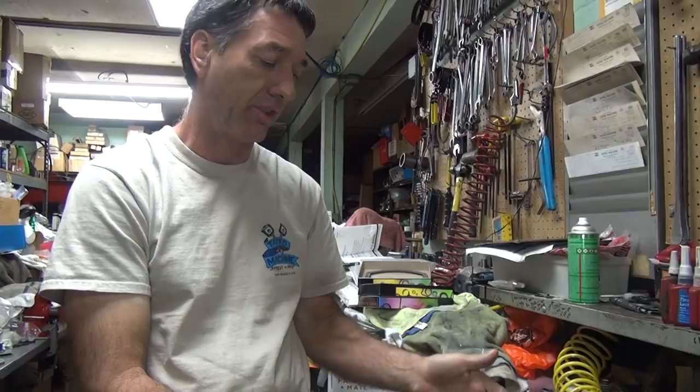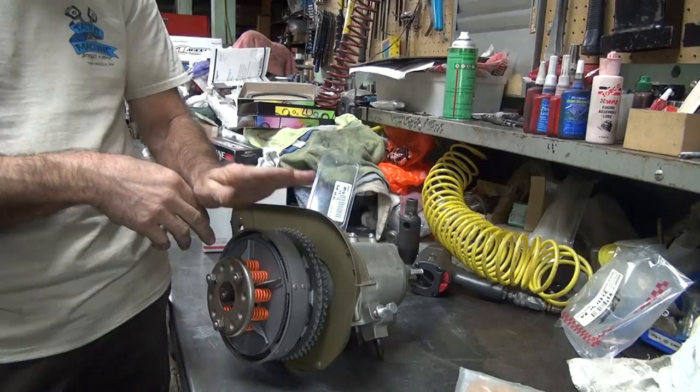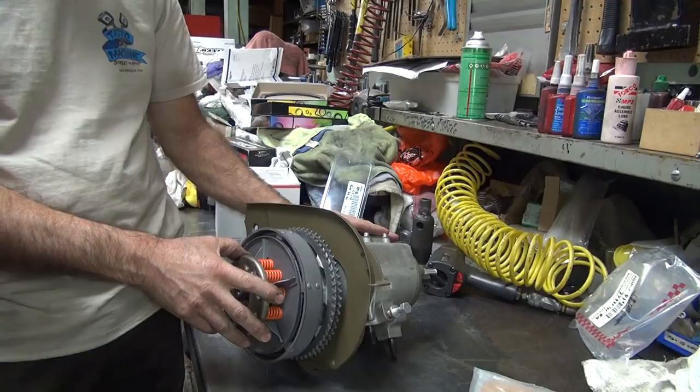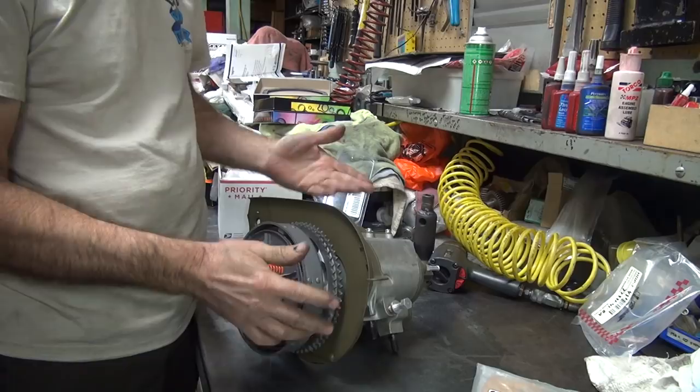And then wherever that spot is, you adjust it down here and lock it down. Then you adjust your foot pedal cable, in the cable front for the rocker, where you want the rocker to be to work with your ankle. If you don't have it where your ankle works, the bike's a bitch to ride. So you want to make sure this isn't dragging when it goes in the bike. Right now you have lots of clearance on here, but you have to mount it so it works. Sometimes you've got to bend these brackets around a little bit. You also got shifter clearance over here.